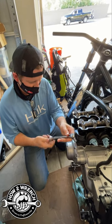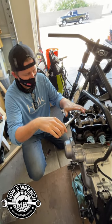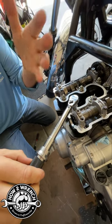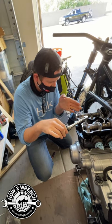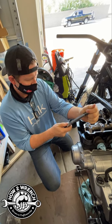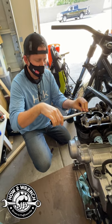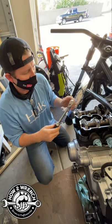So let me model just from beginning to end what I'm talking about. I'll go to something like 50 — I don't even care, it's not that important. Notice I stop because I want the torque wrench to do the work. I'm supporting this, and if you notice, I'm not looking at the bolt, I'm not looking at my hand — I'm looking right here because I want to see that articulation. Then I'll go to 96. That felt good. I don't feel like the bolt is stripping — maybe this does have a higher torque value.